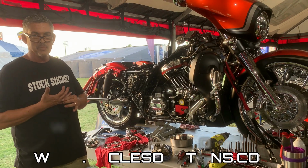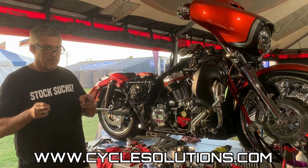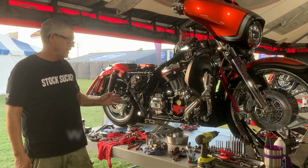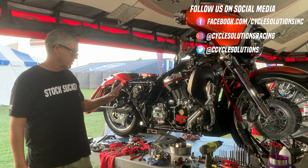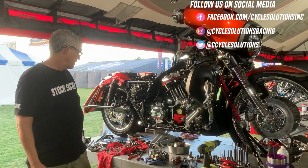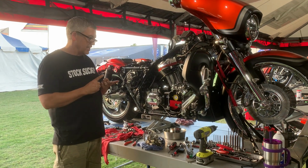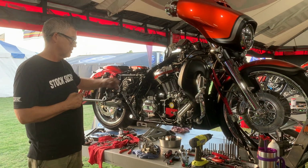Hello, this is Chris Waddell from Cycle Solutions, coming to you live from Panama City Beach, Florida, 2020 Fall Rally. We actually got to do 4 rallies this year. So the first sale we made was a customer who's dissatisfied with his Stage 5 Harley 131 he had put in the bike. List of things we're going to do. We're doing a 70mm HPI throttle body, a set of 7.1 injectors. He already has a D&D billet cat and a Thundermax, so we got that covered.